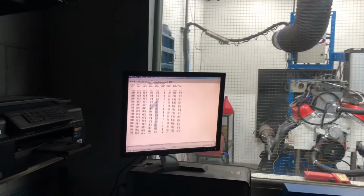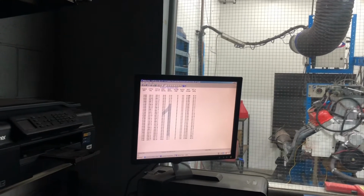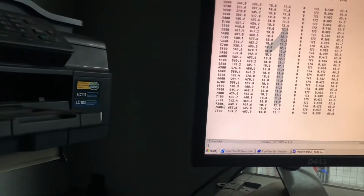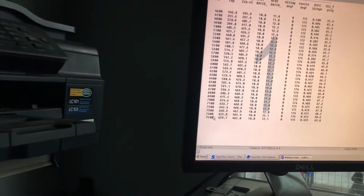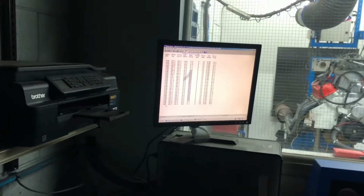Or 40 horse. Well, look how much it's gaining over 100 RPM. How much is it gaining over 100? Even over 500, you're going from 624 to 659, so that's going to put you at 780 horse, and it keeps gaining the same. You raise 5 horsepower each 100 RPM, so we gain 25 horsepower maximum.